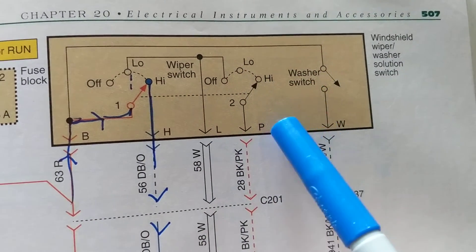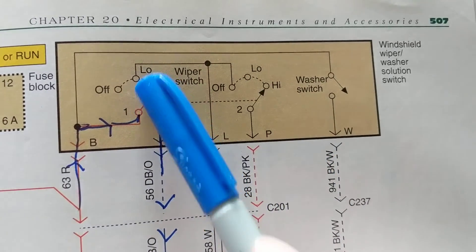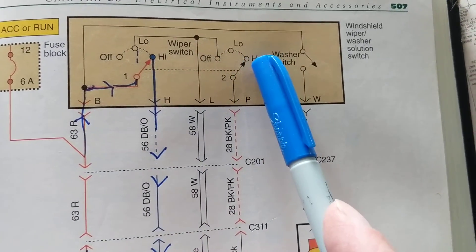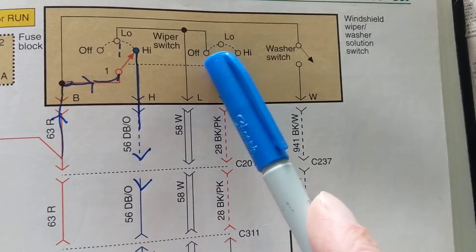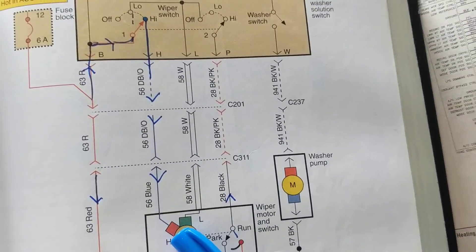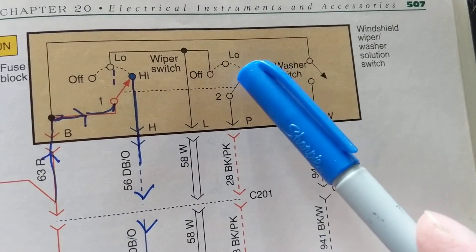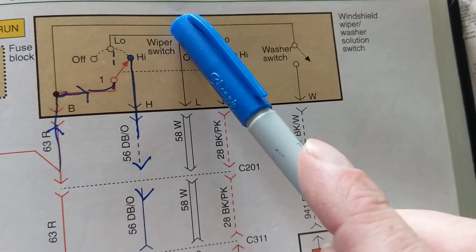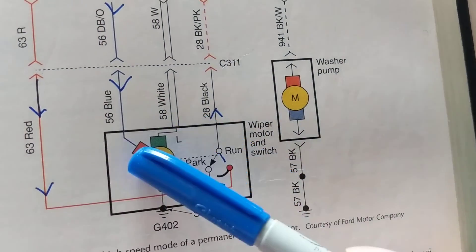For example, if I put the switch in the high position, both switches are in high simultaneously. If I put it in low, both are in low. In the high position, the second switch has no connection — it's out of the picture — but current flows through the first switch to the high brush. When we switch to low, that first switch has no connection and the second switch is in the picture, so current flows through to the low speed brush.